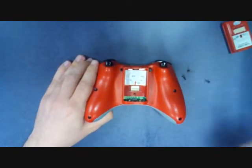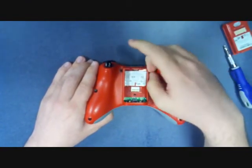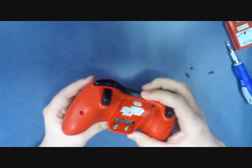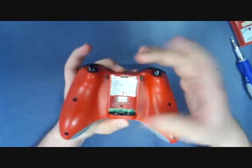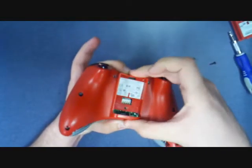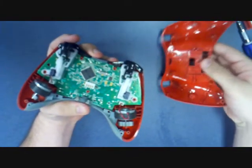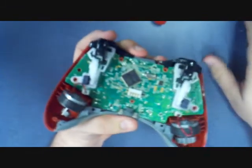We've loosened up all the screws, and some of them are still in there, but that shouldn't matter. What we're going to do is we're going to grab the charging port and the mic connector, and we're going to grab the battery pack and rock it forward — and here we go. Just like that. Make sure you don't lose your screws, and we have all seven of those.